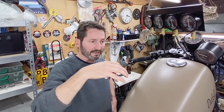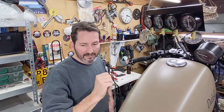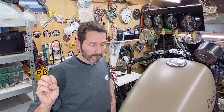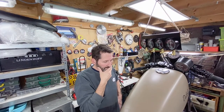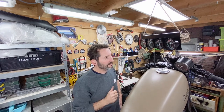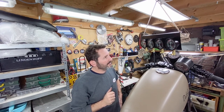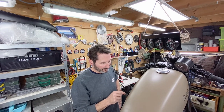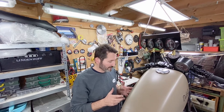And as soon as I open the throttle, boom, boom, like that, it takes quite a long time to pick up. So it's like it's sticking or it's drowning, and I can hear the exhausts exploding all the time. So it could be the timing problem. I've done the ignition plate, I've twisted it. It did improve it, but I think I've got to look at the valves, because probably the timing isn't correct for some reason, or it's changed, so I'll have to check that again.